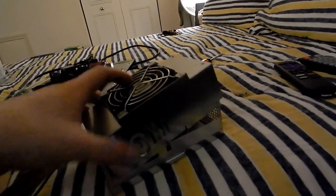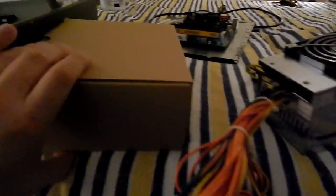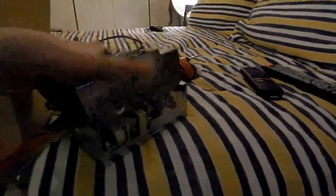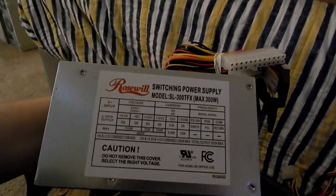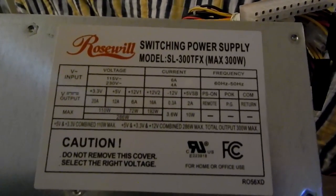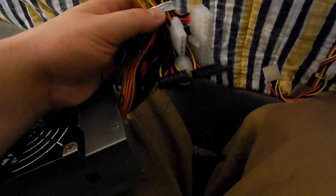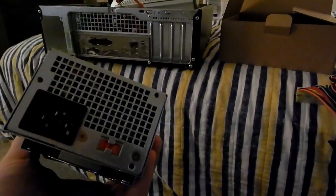You know how things were in the 2000s. The replacement is a Rosewill 300W power supply, and it's quite a bit heavier than the original. The 12V rail has 16 amps instead of 13, so it's a little better suited for the job. It also has two SATA connectors on it, which is nice — the original only had one, so it's a bit more modern and ready for the job.